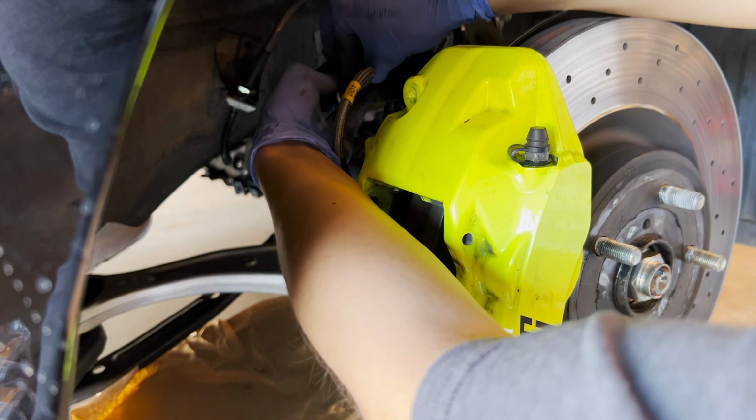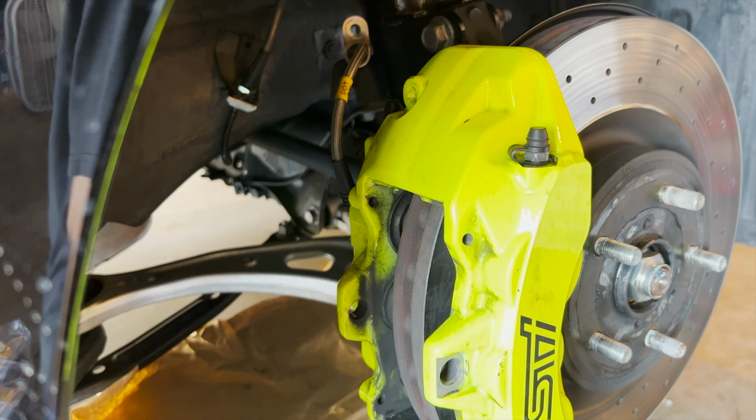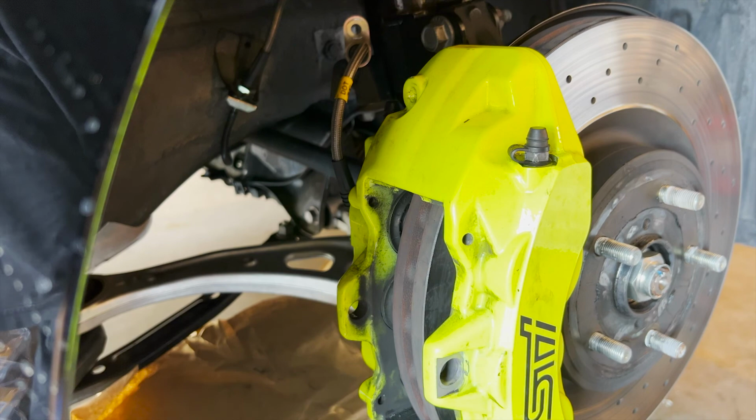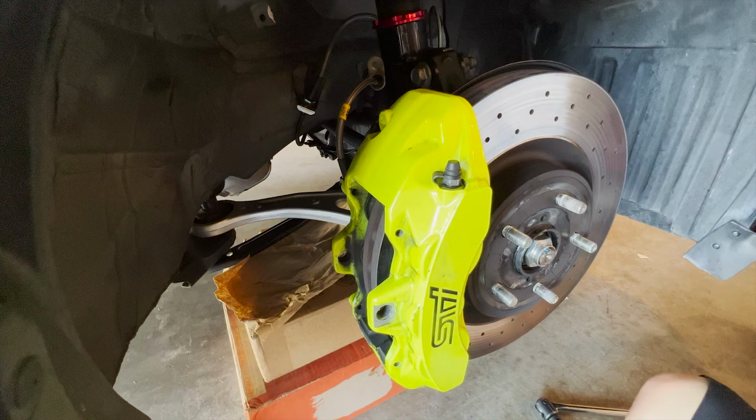It's off right here. Shift this right here. There. And then the caliper is way in the back. It's a 19 millimeter. Just break those two and then start breaking them off. And then we can slowly take the caliper off. Okay, so I finally broke the bolts loose.